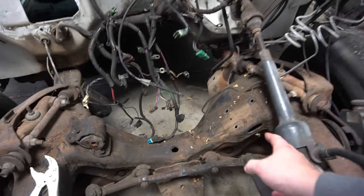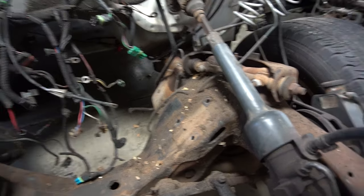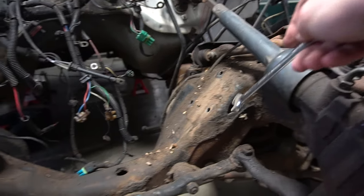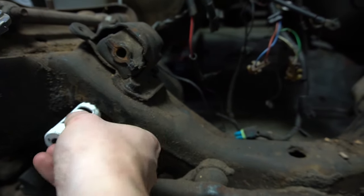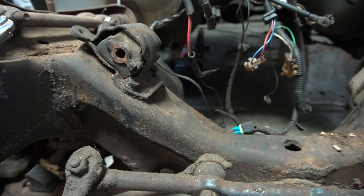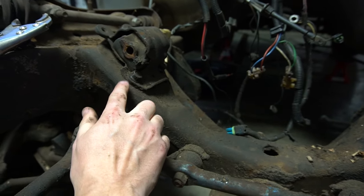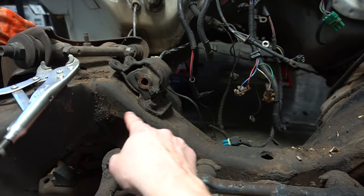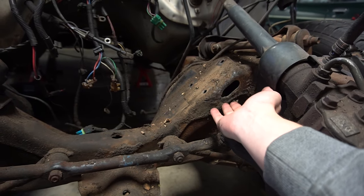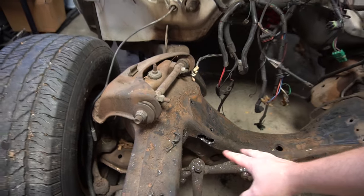Before we can get the engine mounts on, I had to remove these - this is where the stock fuel lines come through. Popped the fuel lines out and got those out of the way, then you can reach in with a wrench. Over on this side there's no way to reach, so I'm going to take a hole saw and cut a little notch here to reach back in and get a wrench in there to tighten up the motor mount bolts. I originally thought it had a threaded insert in the K-member but it doesn't, so we'll notch it. We don't have to put the fuel lines back since I'll be running an inline to the new intake.